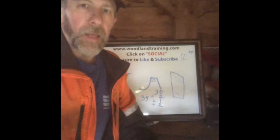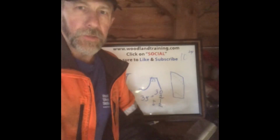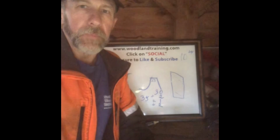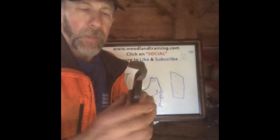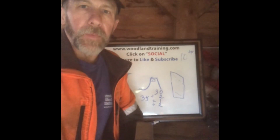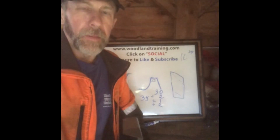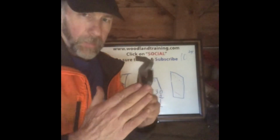Competition chain is just that. A nice flat mowed field, log sitting in a sawhorse, nice and secure, and you just gotta rip through that thing as fast as possible. That's a lot of fun, go for it, but don't change your depth gauges as far as shapes and so on, thinking that's gonna get you anything out in the real world. It makes the saw chain in the saw more dangerous to extreme kickback.